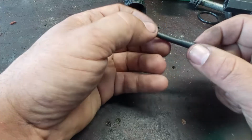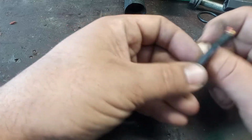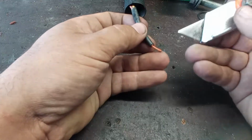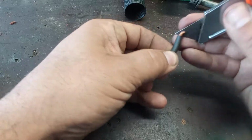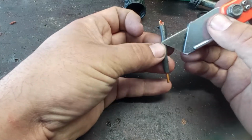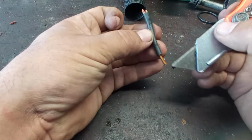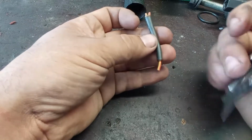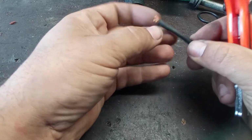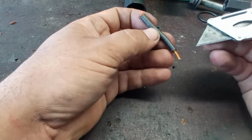Well, sometimes with the naked eye, you really see nothing. And you really have to be very sure that you have a problem in this area. So I know I have on one wire over here the voltage of the battery. I have the interconnection on the inside, or the soldering. And for this door and for that door, I have only 2.5 volts. So even if we do not find anything on the inside, I know that probably, in a manner that I cannot see with the naked eye, it has a problem.